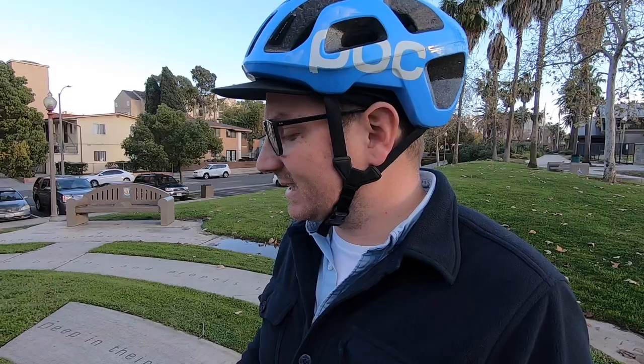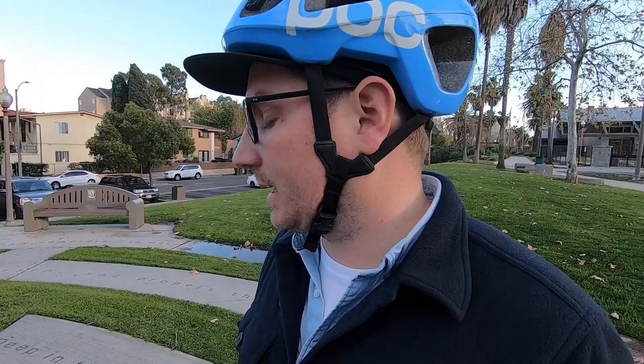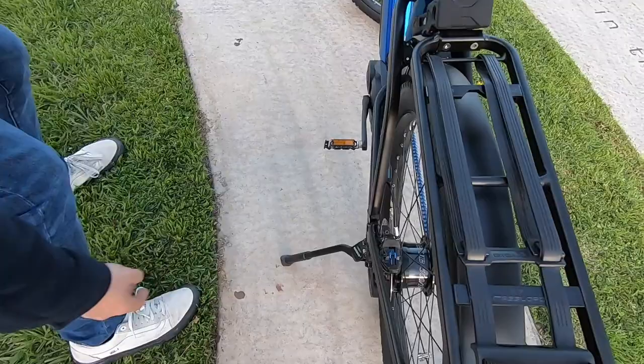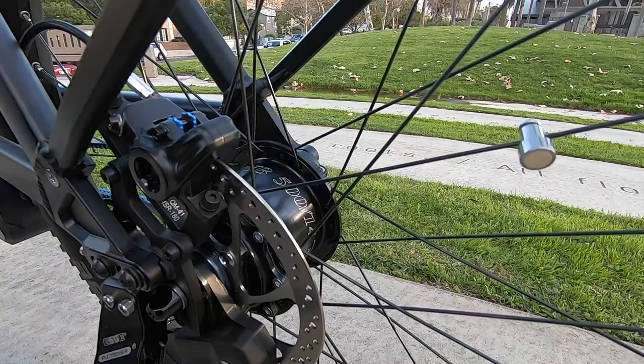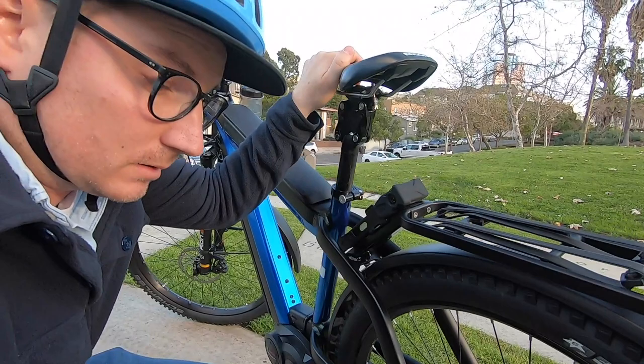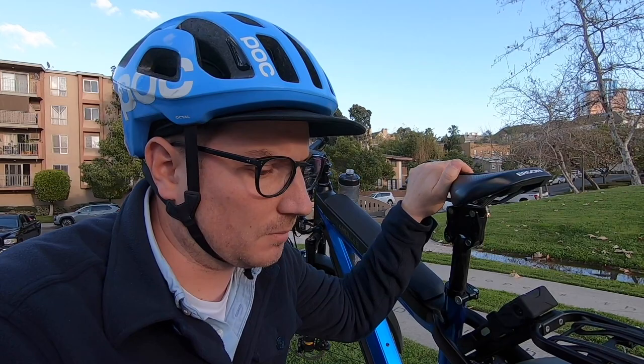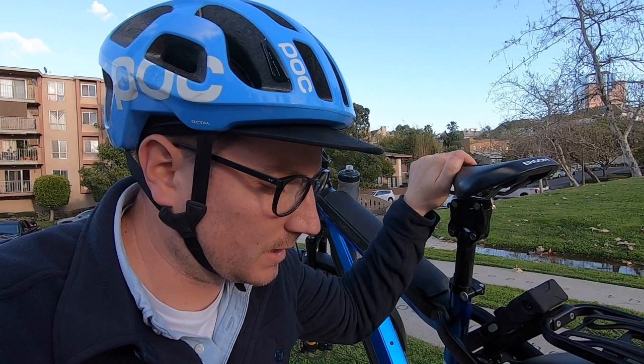This electronic integration, the systems communicating through the CAN bus of the bike, and I'm not sure if you showed the unit here, because basically the hub is exactly the same as a non-electric shifted version, but it's adding this little servo on here, if you will. Is there a battery? This one's wired into the main e-bike battery, and at the moment, as a lot of people ask, it's only available on the Bosch system. So they've chosen to only make that option available with Bosch at the moment. Yeah. Who knows what the future holds, but that's the deal there.